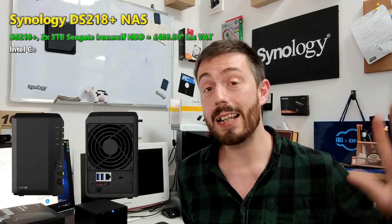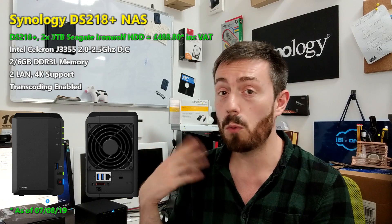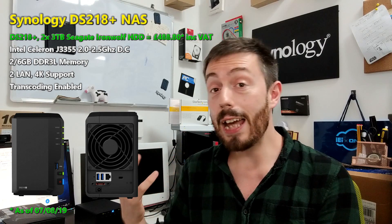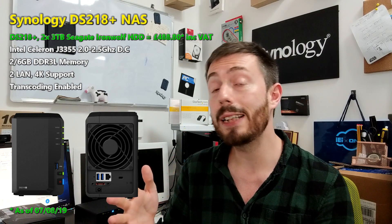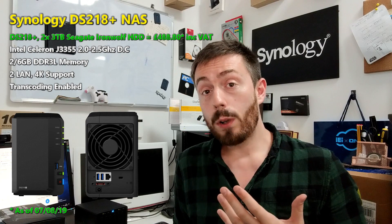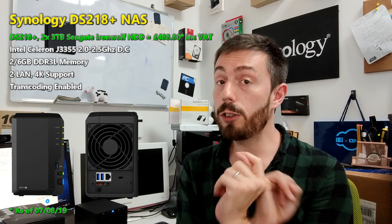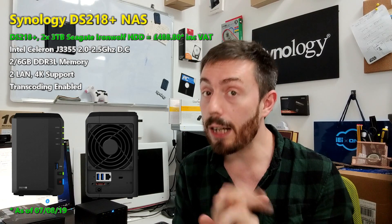Without further ado, let's go to the first one. Even now almost two years down the line, it is still one of the best for your money: the Synology DS218 Plus. It is probably one of the most popular two-bay NASes I've ever seen Synology put out — not since the 214 Play have I seen a NAS that ticked so many boxes. This device is a two-bay Synology NAS. It's got two years of warranty, DSM up to 6.2, and a dual-core Intel-based CPU — the J3355. That CPU can play back 4K media, is rated around 1500 on CPU benchmark, and it can transcode 4K and 1080p media in Plex.